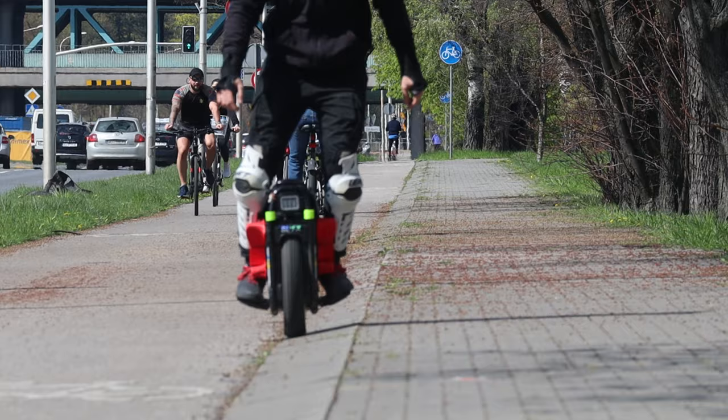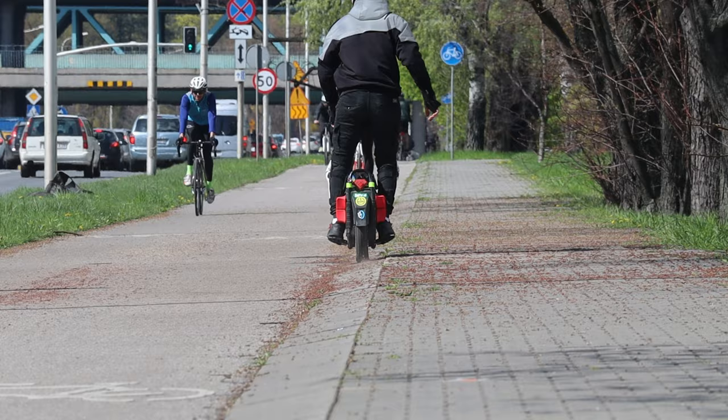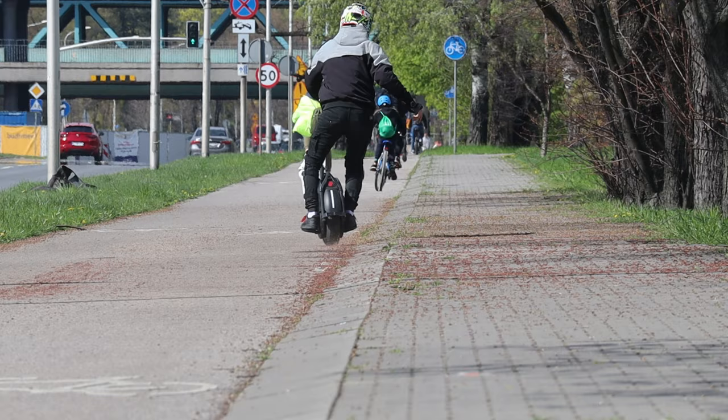Electric unicycles with wider street tires, like 16x3 inch or 18x3 inch in general tire diameter, so until the edge of the tire, typically exhibit more tram tracking. This phenomenon might be further enhanced by harder, stiffer sidewalls, a flatter tire profile, or a low-profile tire like we can see here on the Z10. The faster you go, the stronger this effect will be.